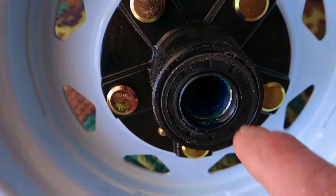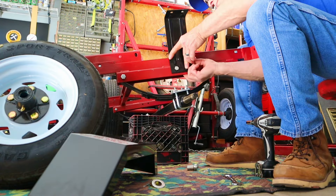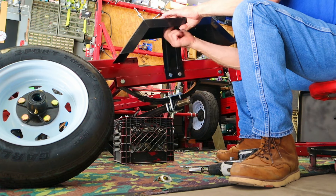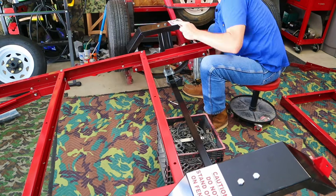One of the big questions about these trailers is whether that blue grease in the bearings is okay to use — that is not cosmoline, that is bearing grease. Before we put the wheels on, we need to get the fenders on because those bolt holes are not going to be accessible once the wheel is on. Attaching the fenders is pretty straightforward: first attach the fender bracket to the leaf spring bracket using two M10 bolts with nuts, then attach the fender to the top of that bracket using the same M10 bolts and nuts. Do the same on the other side.